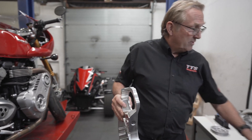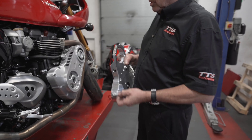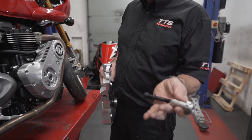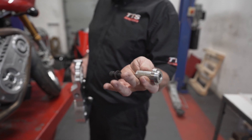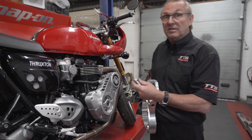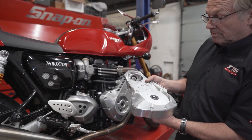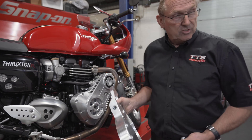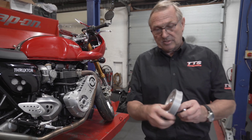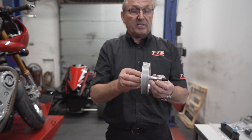The drive, like most of our drives, comes straight off the end of the crankshaft. We've got a spigot with a hex drive, relying totally on friction and bolt pressure to give you the drive. It's a 12mm bolt torqued up to 110 foot-pounds of torque, which will drive the pulley quite nicely as long as you keep all these faces and the faces in the end of the alternator clinically clean, put it together bone dry, and apply a little bit of grease around the oil seal. You then put the pulley on the spigot — same hex drive for positive drive — and that bolt is torqued to 110 foot-pounds. Simple as that.